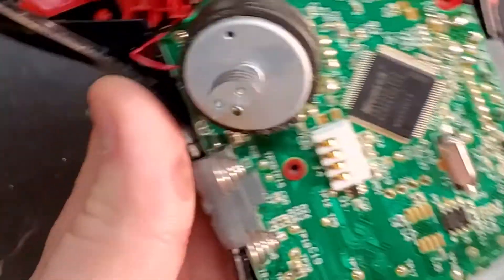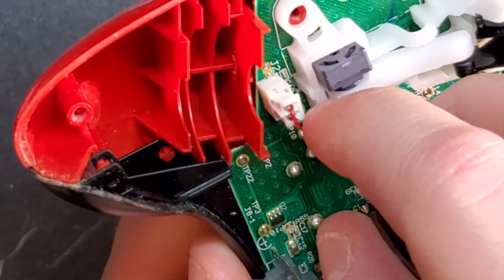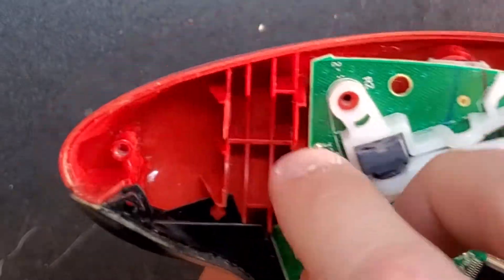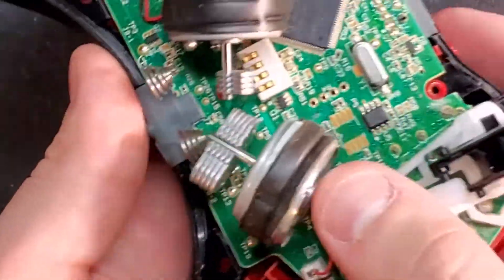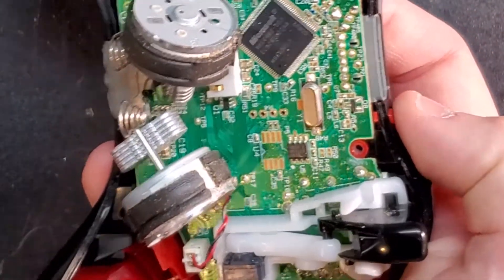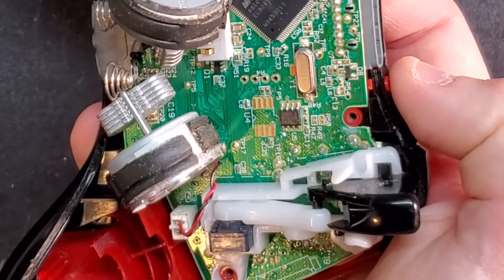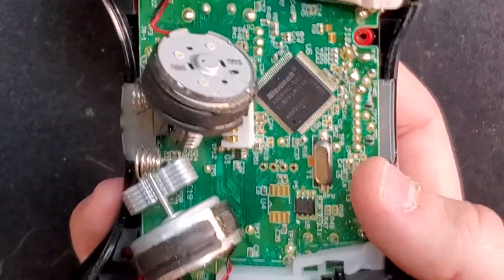The thing you want to be careful with are the rumble motors. There is a little JST connector where you can just pull them out if you want. I'm going to leave them in to keep it all together. If you wanted to completely get rid of the rumble for this controller, you can just leave them out — it works fine without them. It reduces the weight and takes out the rumble, so you'll never have to worry about it again. But again, it's all preference.